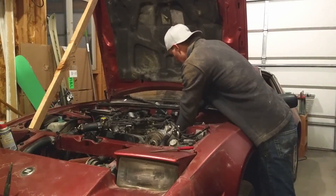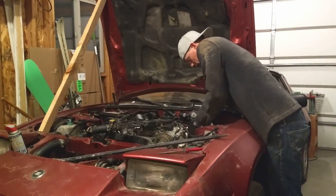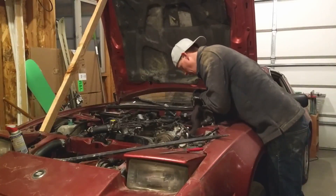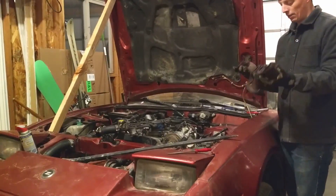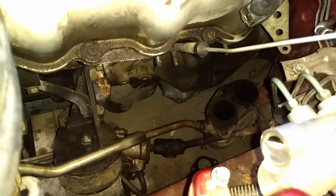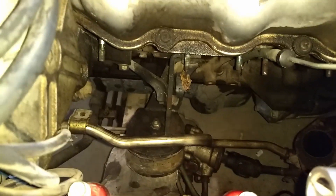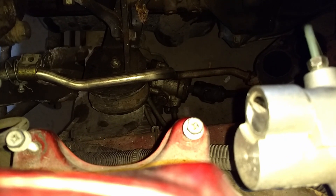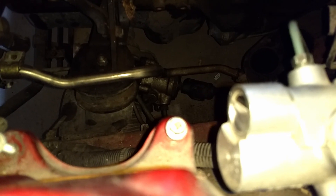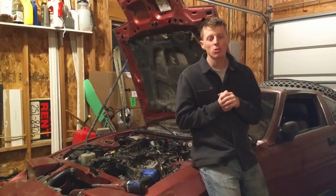It's definitely tight still, but it seems to be moving in the right direction. Finally got this thing off. After the manifold's been removed, you can see the exhaust down there — I'm going to have to remove that as well. There's starting to be a space created in this area. The biggest issue right now is where that motor mount is. What happens when you do the turbo swap is you remove this motor mount and actually the whole cross member under here attached to the motor mount. The turbo version is flipped around so that this motor mount comes out here, moves forward a bit, and that's what creates the space to attach the turbo down there. If you want to follow this build, just hit my logo to subscribe and thanks for watching.